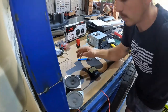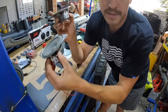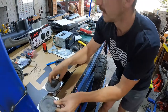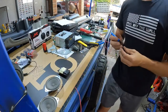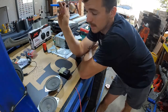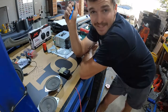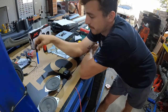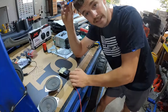Because these are interchangeable speakers with the same part number from Toyota, I know this is going to be the negative side of the other one as well - so blue's negative, green's positive on my front right. For all the 79 Series owners out there, I'll post this up in the comments because I did so much Googling trying to find these and couldn't. I'll put it in a pinned comment with a full rundown of the colours. Anyway, I've got a couple more wires to work out, so let's get back into the car.